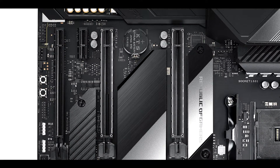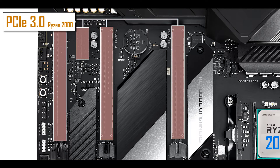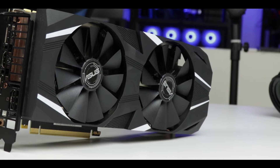Expansion-wise, we have to be careful. If you're running this with a Ryzen 3000, you unlock PCIe 4.0, which doubles the available bandwidth per lane. If you run it with a Ryzen 2000, you'll be running PCIe in legacy third generation, which is half the bandwidth. For this year or possibly the next six months, that doesn't matter much because all available video cards don't yet max out what PCIe 3rd generation can bring them.